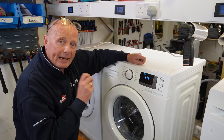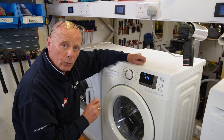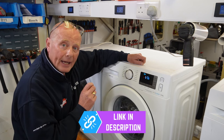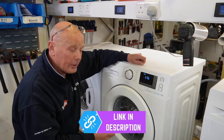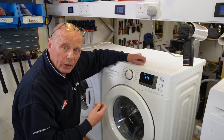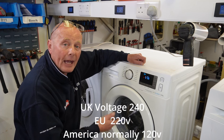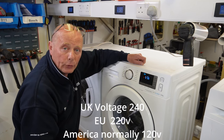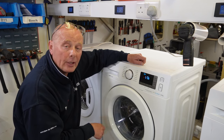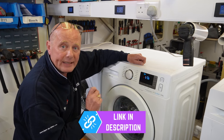If you have a heating problem with your washing machine, I have another video on this at the website or in the YouTube playlist at the end, showing how to test and replace the element. What you could do is use a multimeter with crocodile clips on the terminals, attach this to the two wires underneath the machine, and this would show whether you're getting 240 volts at the heating element. If you are getting 240 volts but the machine is still not heating the water, you may have an open circuit element, which you will see in the other video.